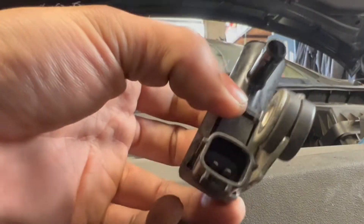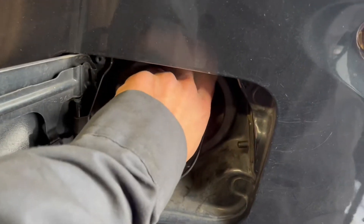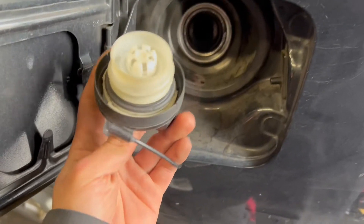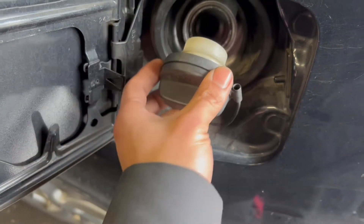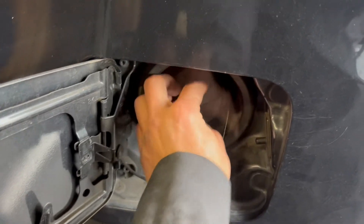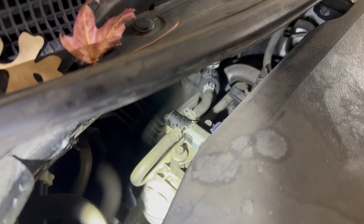There are a lot of problems with the gas cap and the vent valve next to the canister. Standing here I can smell gas coming out, and you can see the gasket here is broken — it's ripped off right here, half the piece is missing. That's why there's a strong gas smell, that's why it was leaking, and that's why you have that code. This is the main problem, so I'm going to buy a new one and put it in.